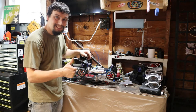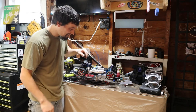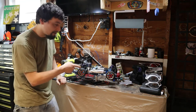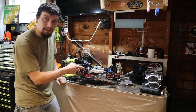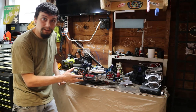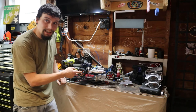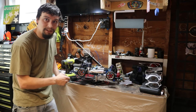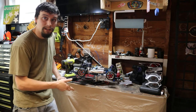It runs! The clutch is still winding down there, so pretty good. I'm going to get a temp gun and some fresh fuel — it might be a week or two before we actually go through and do the break-in. I've been looking into this Bones Brew that a lot of nitro guys use — it's 30% nitro and 10% oil. I think this old fuel I have has gotten some moisture into it, and that might have sped up the process of losing compression in this little engine. So I'm going to get it out of my T-Max and get both engines tuned up.